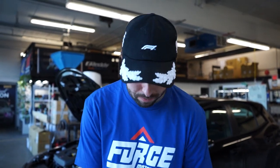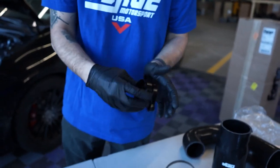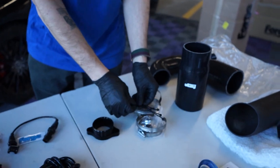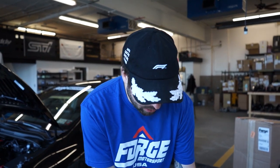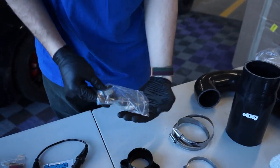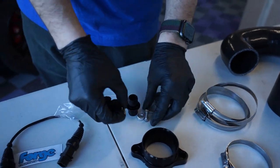We're going through this together, we'll explore it. As far as the turbo inlet, we have our bag of hardware right here. We have this CNC aluminum piece which mounts to the turbo itself. We are gonna reuse the gasket on the factory one. We got some zip ties - probably just to route some factory wiring around. A couple more hose clamps, worm clamps, and then some hardware for the turbo inlet as well as what looks like some sort of reducer for a vacuum line.